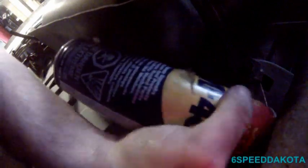The one good thing is once you get the bolt started, give it a little shot with some WD-40 or your penetrant of choice. What that'll do is get some lubricant onto the rusty threads, because the rusty threads are the ones that typically sit above the nut, and that'll aid removing the nut. Anti-seize works too if you can actually get in behind there.